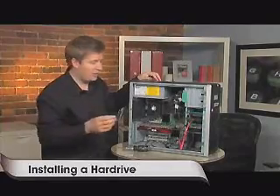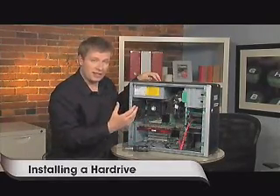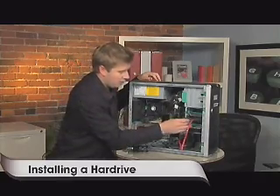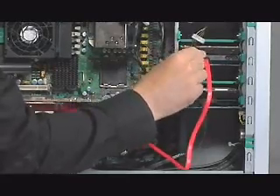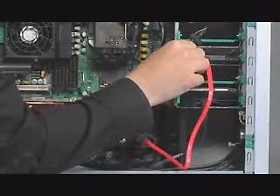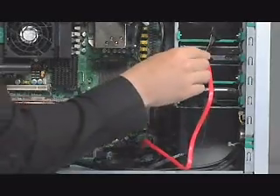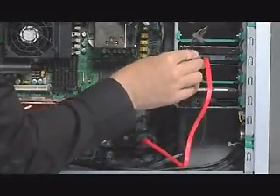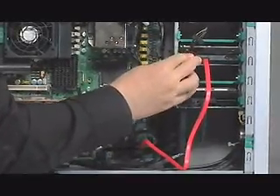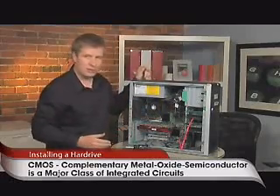One last step — we need power. We've connected the physical drive to the motherboard so the computer can actually see that the drive is there. The last thing we need to do is just plug in one of these little power connectors right here. You can see that this computer is upgraded so you can put in a number of them. Just slide that into place — it's nice to make it nice and tight so that it won't come off. So we've got the power, we've got the connection, we've got the drive mounted.